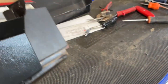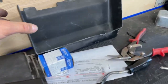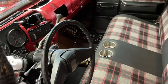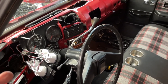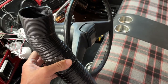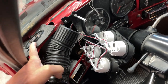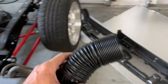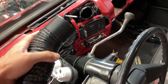For those of you with perfect glove compartments, get ready to cut that thing up so you can install this little miniature version — at least you still have some storage, even though you lose quite a bit. When you're cutting the ductwork for your dash, make sure you leave it a little extra long. Vintage Air gives you an extra four to six inches per piece that you need to run, and the instructions give some measurements. Make sure these are plenty long — it's probably easiest to attach ductwork to the dash and then snorkel them down through the holes and attach to the Vintage Air kit once installed.